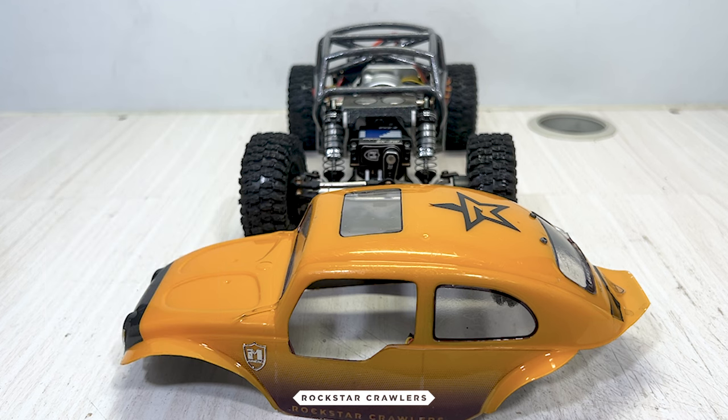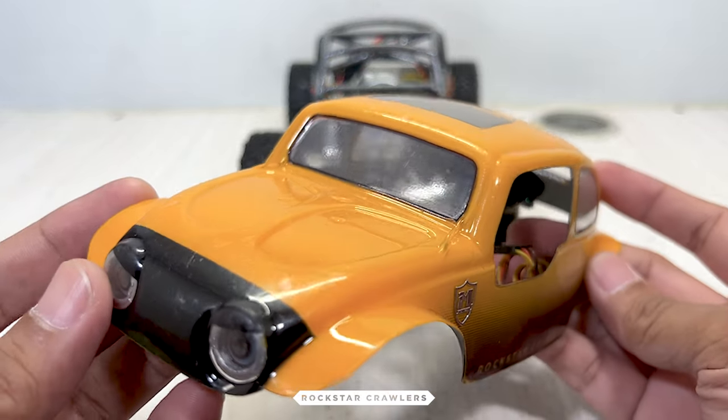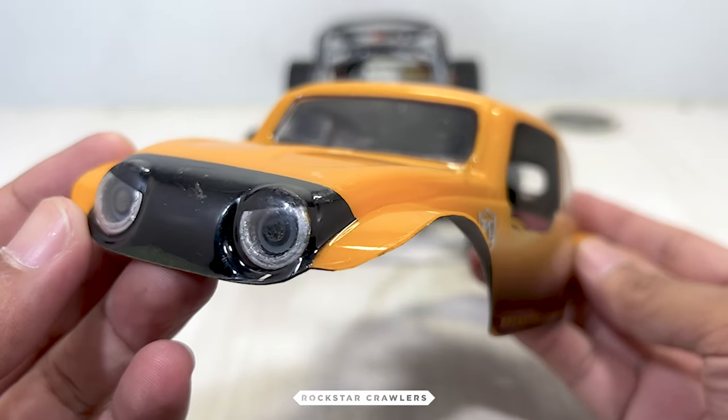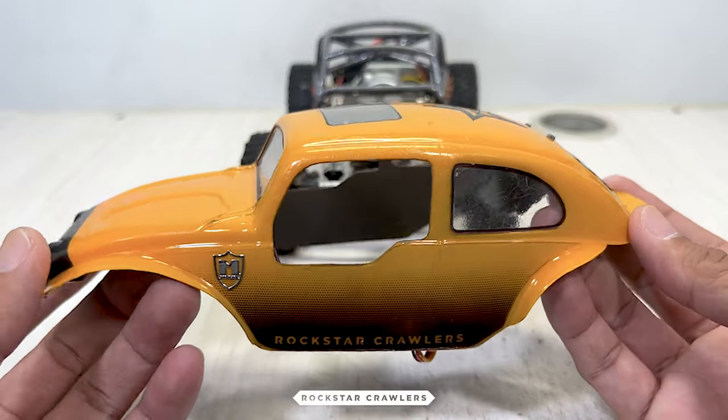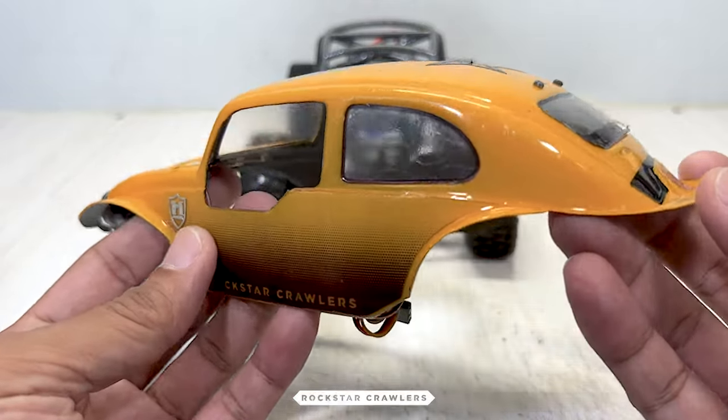The raw body does not come pre-cut, so when I did the cutting, my main consideration was tire clearance because I already knew that the setup had to be slammed due to the heavy gearbox, which we will talk about in another chapter. Front fenders aren't wide and they're tapered towards the front for steering clearance. Rear fenders were cut halfway to allow full compression without rubbing.